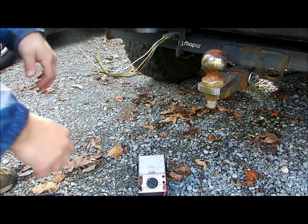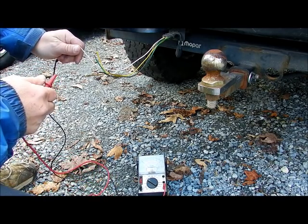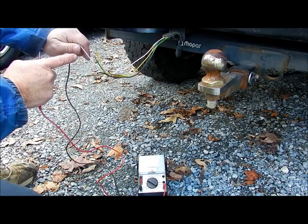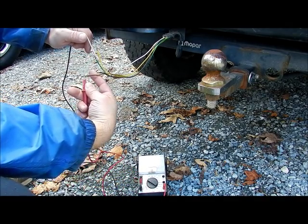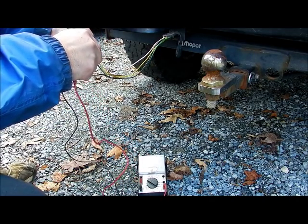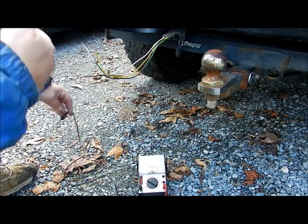Right now the left lights are flashing — I'm making a left turn. I'm going to hold the ground lead. I don't know if you can see the meter, but we're going to see what happens. I'm going to hit this wire. One side is ground. Don't touch the positive side because it is 12 volts. You can see the meter is steady — that's your lights. On the yellow wire we have a pulsating turn signal. So remember, you're making a left turn, so the left side of the yellow goes to the yellow on the trailer.